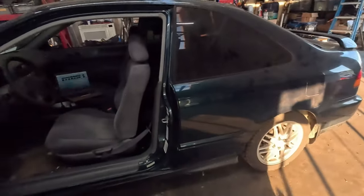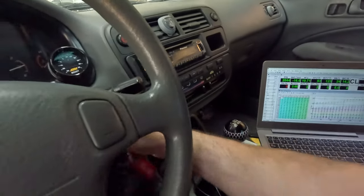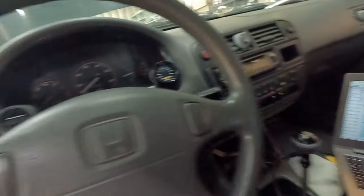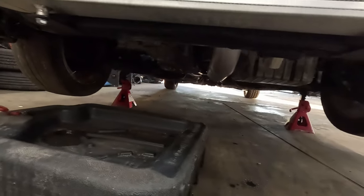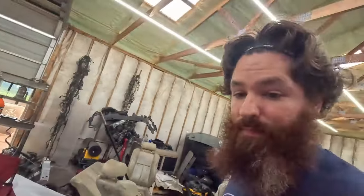After I took some fuel out of it, it just wanted to idle high, so I think we might have a vacuum leak, but it started. I gotta figure out the vacuum leak because I need it to warm up, and yeah, we'll see how it goes from there. We don't have any leaks whatsoever. I'm gonna check the coolant, gotta add some.